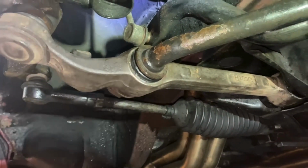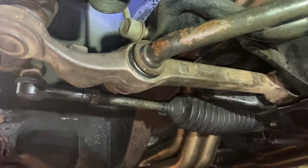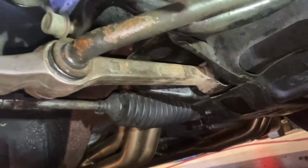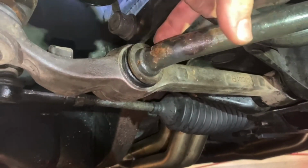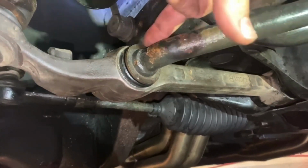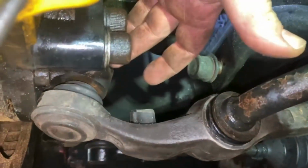And lift up until the weight of the vehicle is on that jack. So this stuff all has tension on it. Every bit of your suspension bolts have tension on it. If you do not do that, when you go to tighten all these down and tighten them to spec, like you should, and the link will be in the description, these are all 74, 76, I believe is the front one, 76 foot-pounds, 74 foot-pounds, 44 foot-pounds.